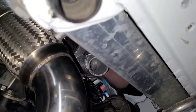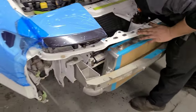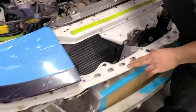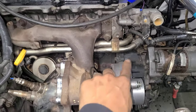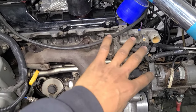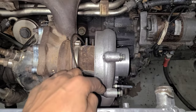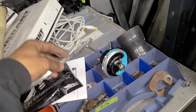You can see the outlet of the turbo is pointing forward, which gives us a lot shorter routing for the intercooler. Usually you have the outlet coming the other way and you have to do this big loop-de-loop around, which really slows the air down and causes it to do a lot of work. Now it's just pointing out — it's gonna be a nice short hose into the side of the intercooler. We've also got our fancy bracket all finished up.